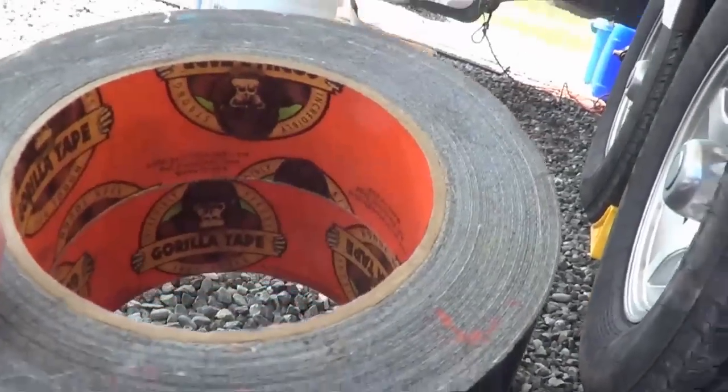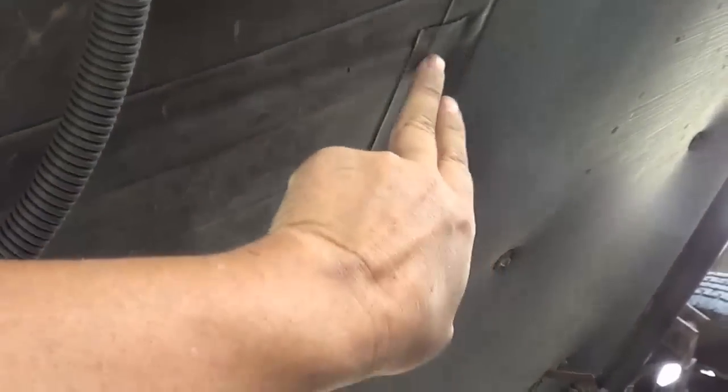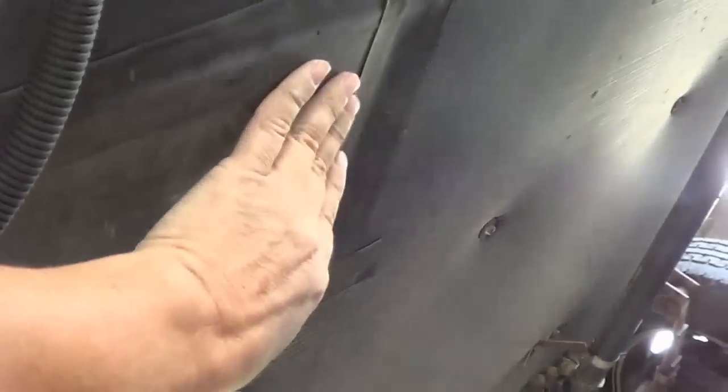Let me just go underneath the rig here. Underneath my Cougar, it has kind of a plastic Coroplast cover. So a lot of times I need to access something. Here's an access port to get at something. I have several of those that I've cut. Once I access it, I need to reseal it, and the Gorilla Tape works really well. Like this port here, I haven't accessed that for years, and you see it's still stuck really well. So that works really good for that.